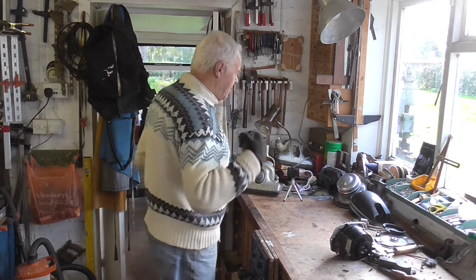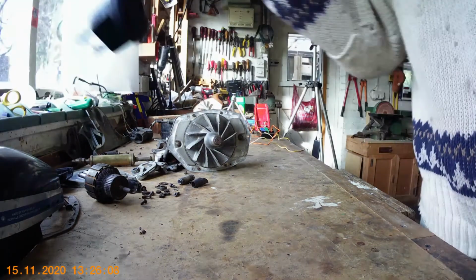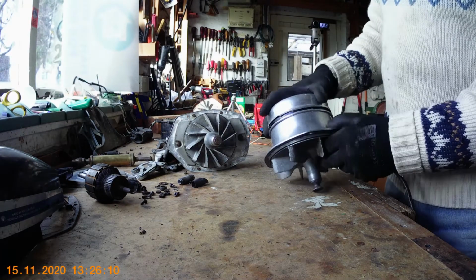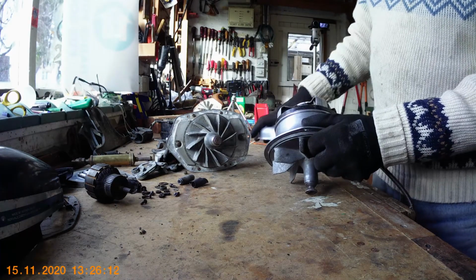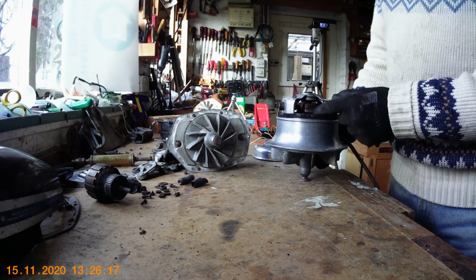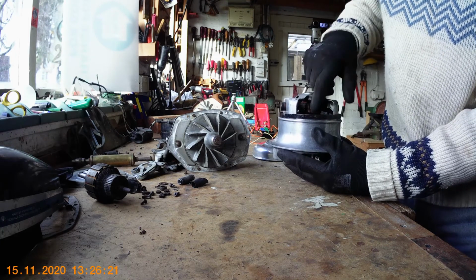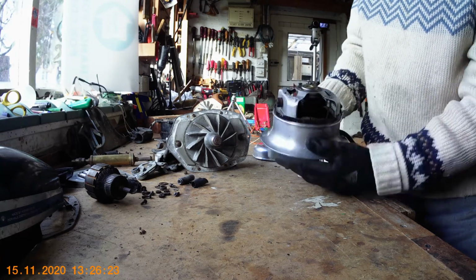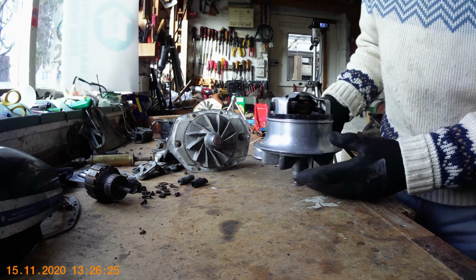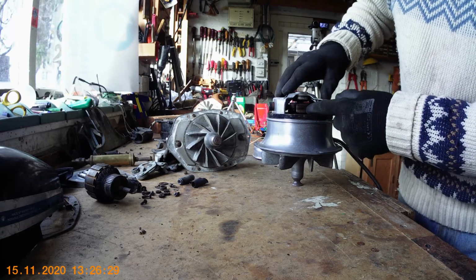One thing I should show you, the differences. One thing I do like about these old motors, this is the old 800 series type motor. What I do like is, notice the armature in this one, you can actually get to it and see it, so that when you've got it working you can see the commutation and everything. I mean, it's a superb motor, that is. But overall you can actually use what we call a com stick on this one to bed the brushes in.